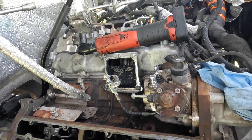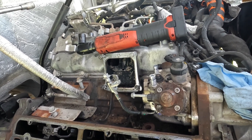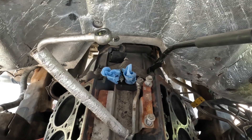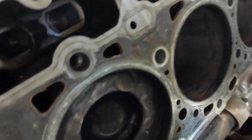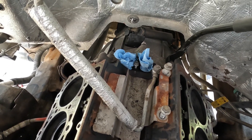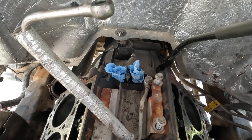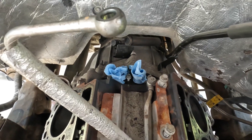I'm expecting the second cylinder on the driver's side to be the cause of the head gasket leak. I got the heads off now and judging from these cylinders they look a little worse than the passenger side. I'm suspecting that is the side that was leaking coolant because all the injector tips were completely rusted and one of the glow plugs was stuck in there and I had to knock it out. I've plugged up all the holes with shop towels.